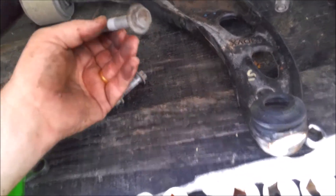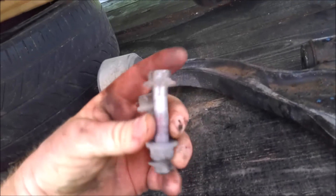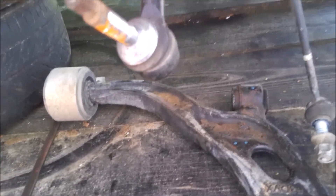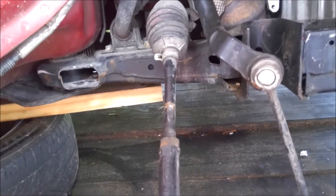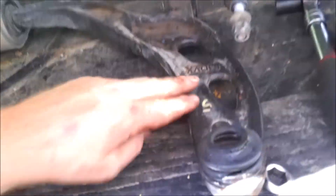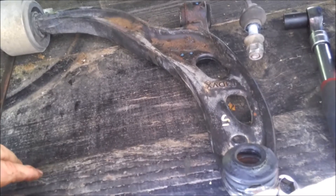I got the lower control arm off. There's an 18 millimeter bolt that goes up under the frame - you've got to get your ratchet inside here. Then you got a 15 on one side and 18 on the other side, nut-bolt combination - two of them back here on the frame. Pull those two bolts out and this thing should come out with a little bit of finagling. Luckily the frame's not bent in any way on this car - everything looks pretty straight and square. The old control arm's got marks from the insurance saying it was bent.